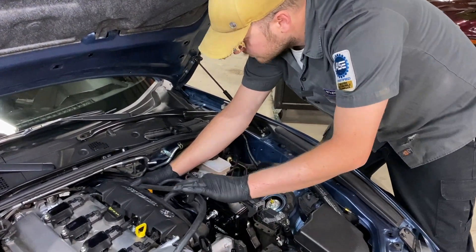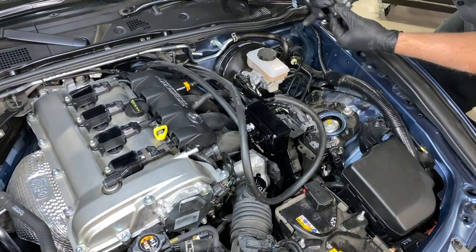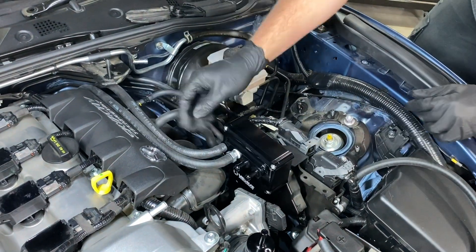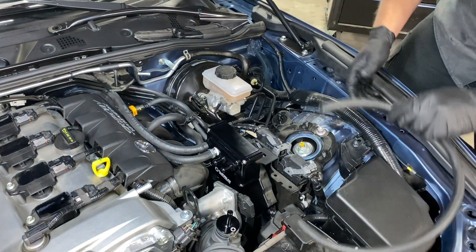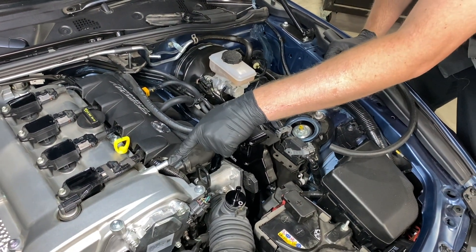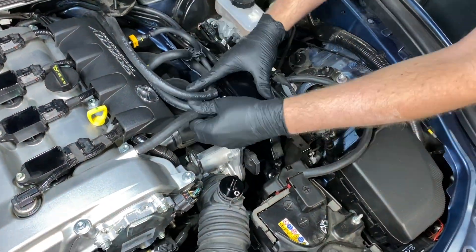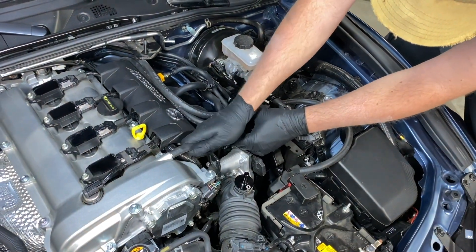This one is the front. Cut. We can tie these up later with zip ties to make it nice and neat and orderly. You have two more ports: the second port goes straight ahead to the valve cover, and the forward-most port will go into your intake tube. You want a little bit of flexibility there because your engine is going to move relative to the catch can.